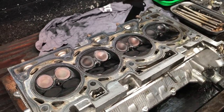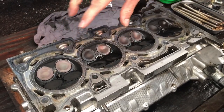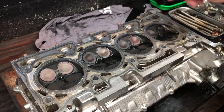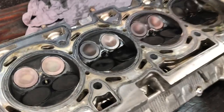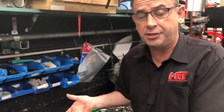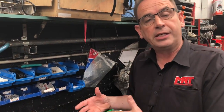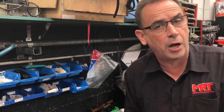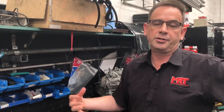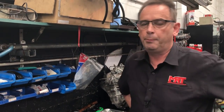What we did work out is this engine does have some problems with the valve seats. We can look at them here and they visually look okay, but what you can't see is how well they're seating on the head. That gives us more accurate information that we need to do a proper dismantle of the head, pull the valves out, and make sure there are no burnt valves. Visually there's nothing dramatically wrong, but it only takes a small amount of leakage on the valve seats to cause you to lose performance. With a new owner, we want to get as much information as we can, so the bottom line is this head probably needs a valve grind, reseat the valves, and put it all back together.